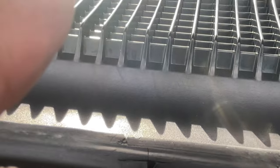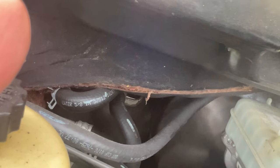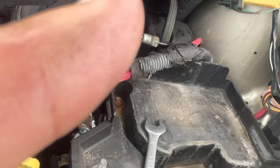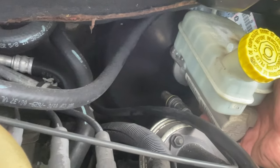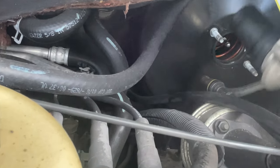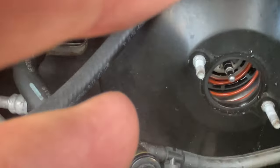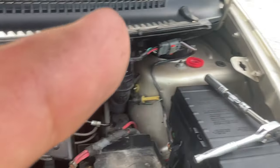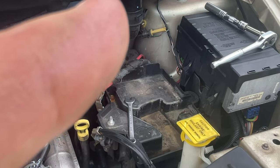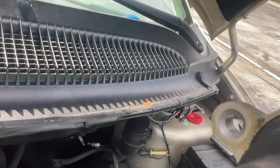Loosen the nuts, get a hold of them, and put them up on the dashboard so they don't fall. The brake master cylinder is on the driver's side behind the battery — you'll have to remove the battery. If the brake master cylinder is bad, brake fluid will be inside the brake booster, which is why you're getting fluid on the floorboard. As soon as I saw this issue, I immediately stopped driving the van — it is dangerous, a hazard, and life-threatening.